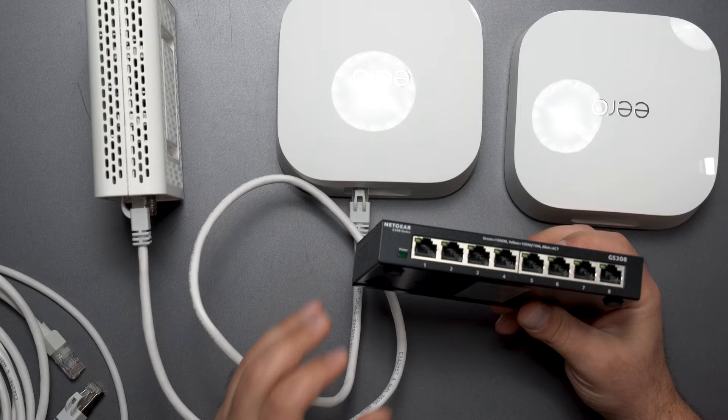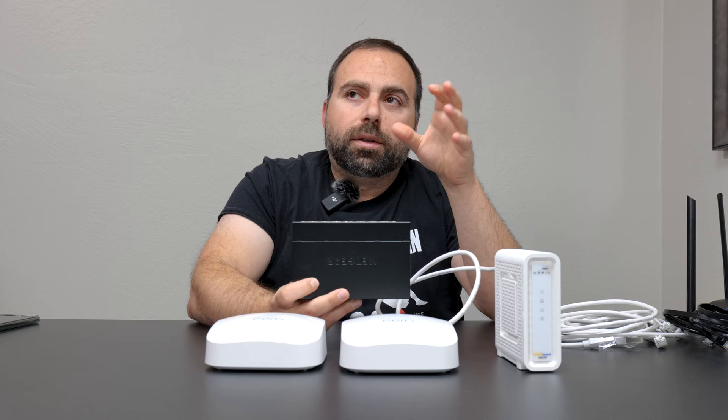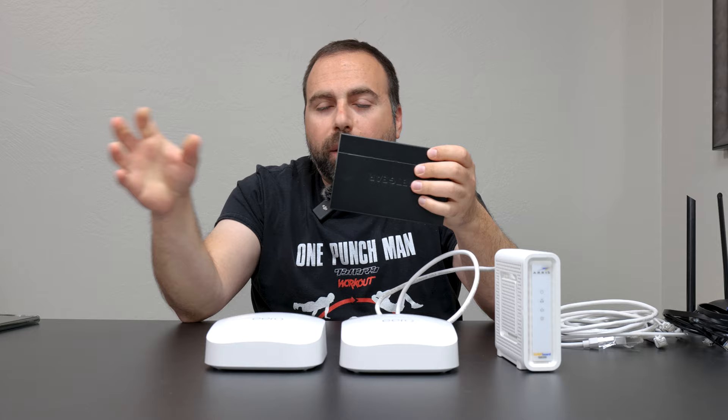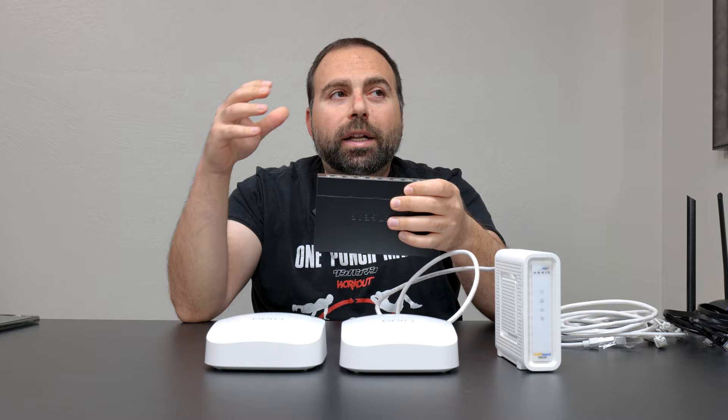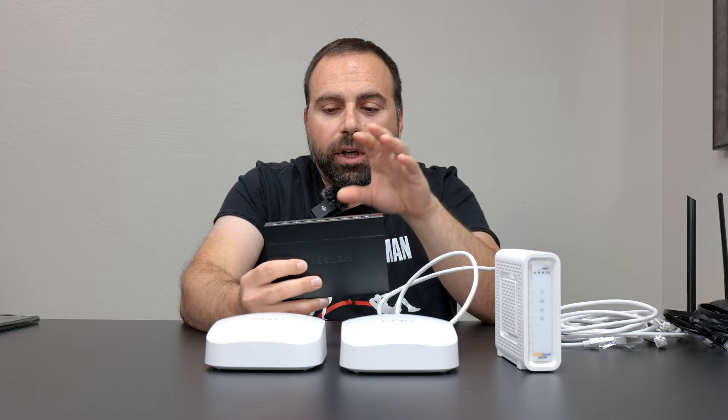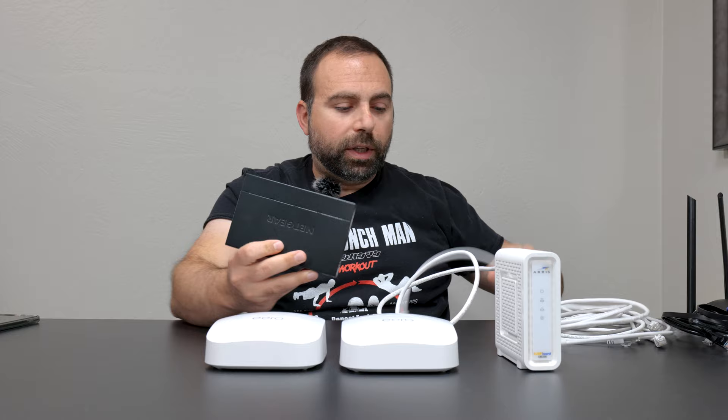What's the difference between a managed switch and an unmanaged switch? The managed switch gives you more options — you can create VLANs, which are virtual local area networks, and you can assign IP addresses using a managed switch. You cannot do that with an unmanaged switch. However, in most cases you don't want to do that through the switch — you want to do it through your router. So an unmanaged switch is the way to go.